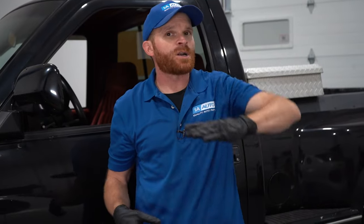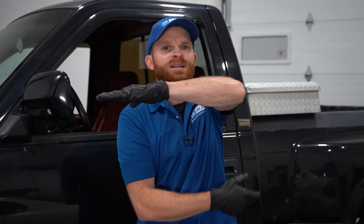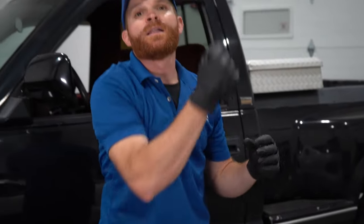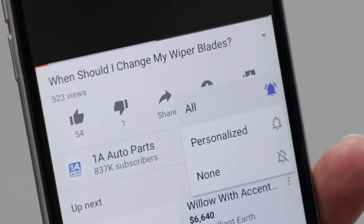I showed you how to adjust those front torsion bars on your vehicle to help bring up the front a little bit. Just keep in mind, if you're towing something, you don't necessarily want to be sitting level without having anything on the back. If you're towing something often, you want to be a little higher in the rear, so that if you have weight it's going to bring it down to an almost level position, but definitely not sitting lower in the rear. I hope you liked the video and learned a little something. If you did, leave it in the comments section below — I always love to hear from you. If you think somebody else might benefit, go ahead and share it with them. If you liked or loved the video, smash the like button. While you're at it, go ahead and subscribe and ring the bell so you and all your friends can be kept up with all of our latest content. Thanks.